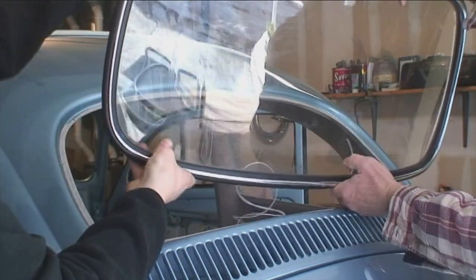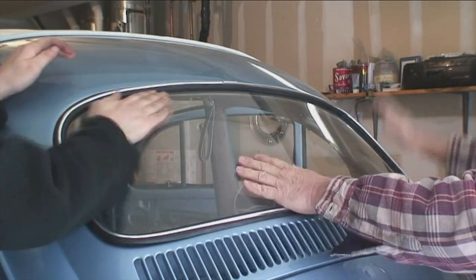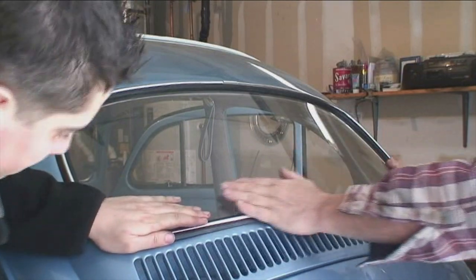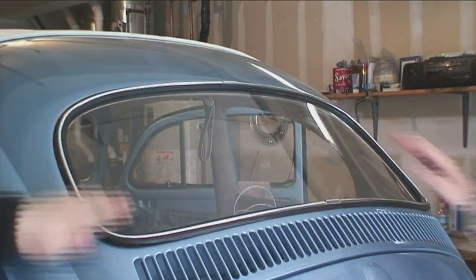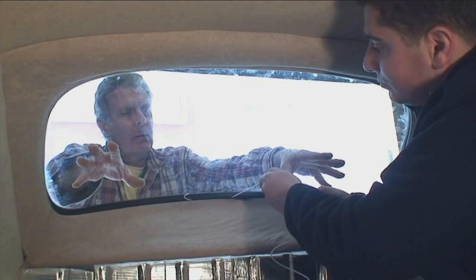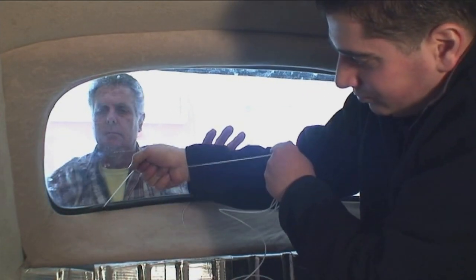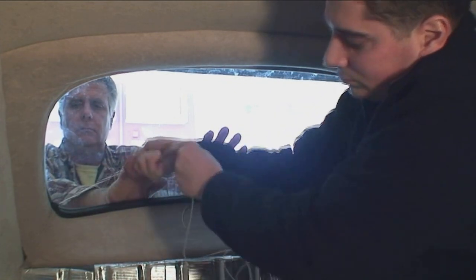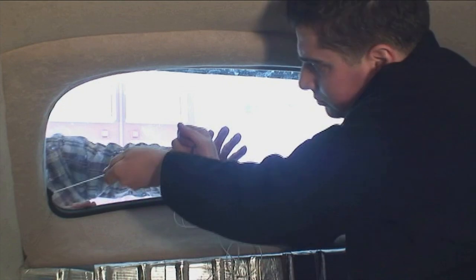Put the wire on the inside and line up the window all the way around, make sure it's even. You want to slap on it and downward — my dad uses his fist, do not do that. I know I have some footage of the Australian assembly line and they actually use a rubber mallet to get some of these windows in. But basically you just want to slap downward. Sometimes I start with pliers and pull upward so the rubber seal will come up over the lip of the car. I start from one section and work my way up halfway on the sides.